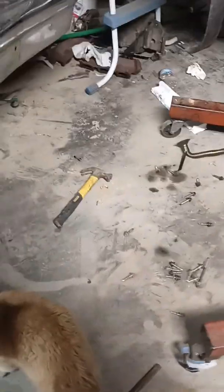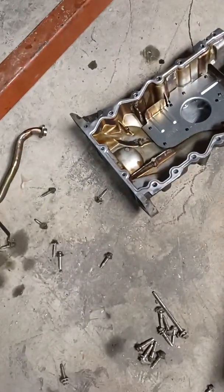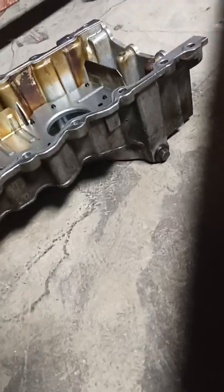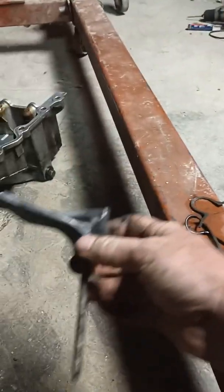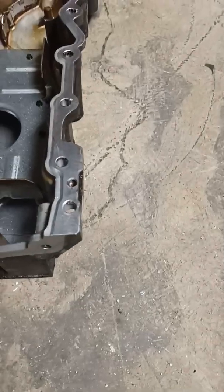That solution is this 3.5 front wheel drive oil pan. The first difference in these oil pans is the sump is in a different place — it's in the back on that one, but on this pan the sump is from the middle front, so it's not nearly as deep and it's to the front. It doesn't have the center bolt here, and one of these back bolts is threaded differently. This bracket here was for the AC compressor on the front wheel drive — I cut it off because it's not on this one. All the bolts are in the same spot.